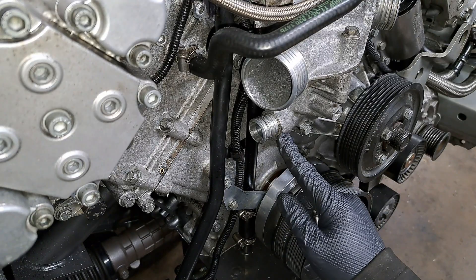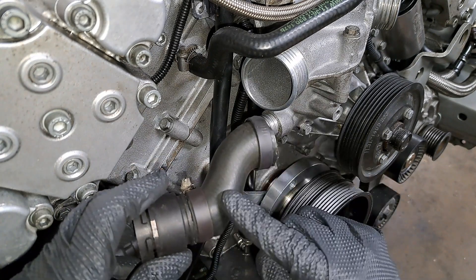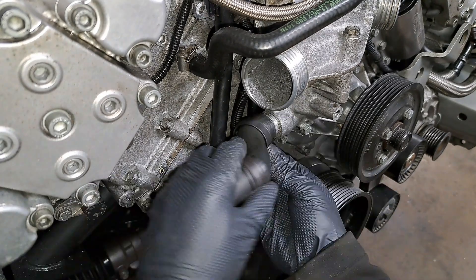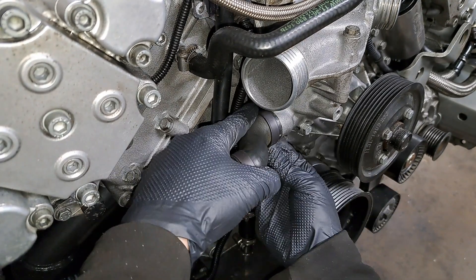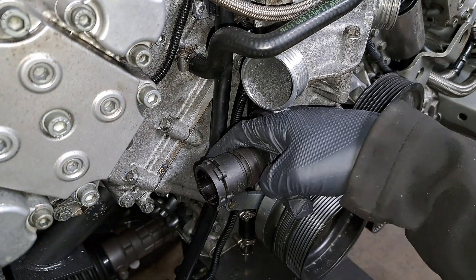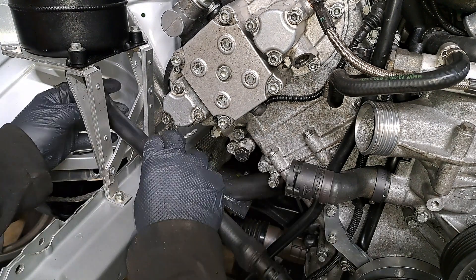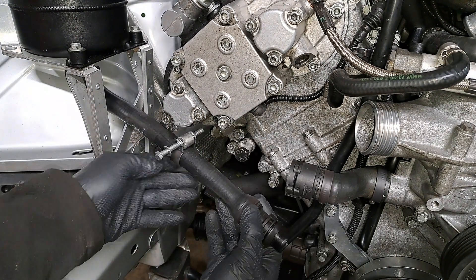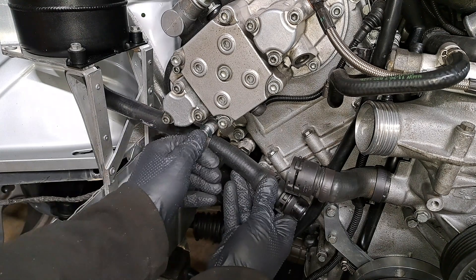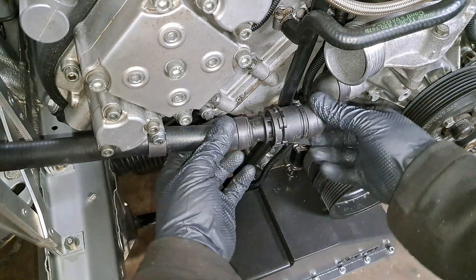The 5/8-inch hose is clamped on, and this 90-degree part goes to the bottom of the tank — they snap directly together. Here is the water pump port. The hose made from the M5 hose with the E60 coupler goes on to it. With the hose installed you can see how it deviates away and gives plenty of room. Then this hose goes to the bottom of the tank, and I have a holder that bolts directly to the engine via one of the VANOS assembly bolts.